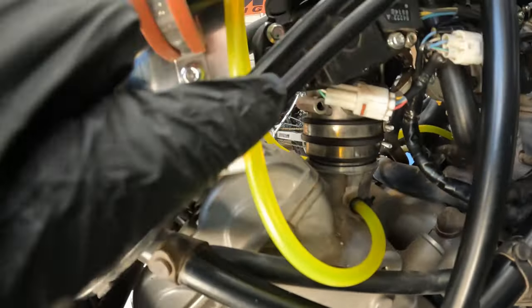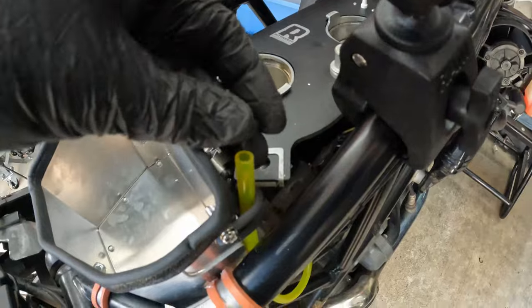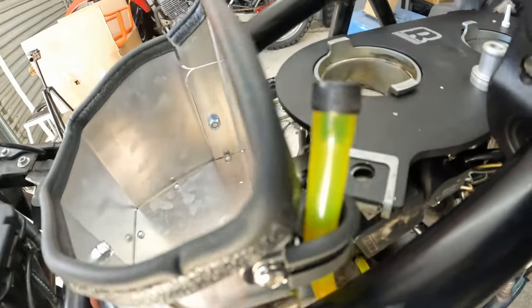If you are doing Stage 3, you're going to run the cable from the back rear throttle body on the right side up. What I did was I mounted it on the doghouse storage, got a hose clamp, and then you're just going to take this little screw that Rottweiler provides and screw it into this hole. At any later time you can come back in and balance your throttle body. That's what it looks like capped off on the throttle body.